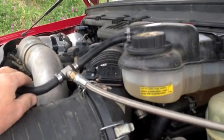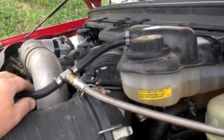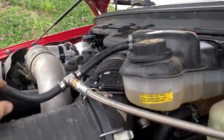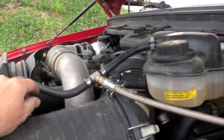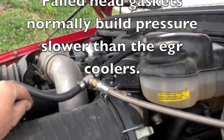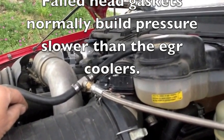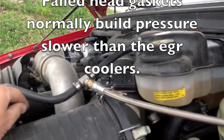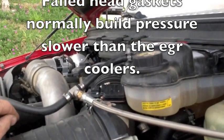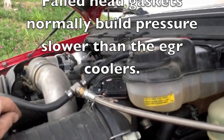When pressure builds up over 16 — it actually takes probably about 18 PSI — it'll vent out the cap and you start to see signs of it. When you have a head gasket issue, the pressure slowly builds. It'll take maybe three or four hard accelerations or maybe a long grade, and the pressure will rise to over 16 or 17 PSI.